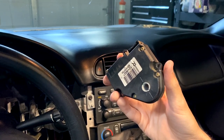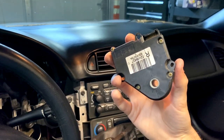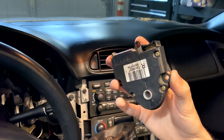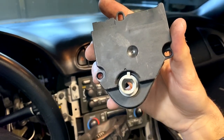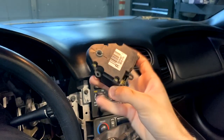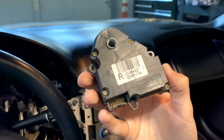With the actuator out of the car, it's a little bit easier to see the location of everything we just dealt with. This is about the angle it's mounted in there — you can see there's that back screw that was kind of hard to show, and the one up front that I demonstrated removing. At the top there's the wiring connector, and then in the middle down here that's the shaft that actually connects with the door, operating the HVAC airflow. If we flip it around, you can see that shaft actually has two flat edges and two round edges — so just make sure when you install the new one that you have that lined up, and it should slide right back onto that shaft. There are some part numbers on there — the original AC Delco part numbers — but I'll show you guys the new one I bought and what replacement part numbers you might be able to use.